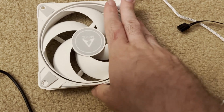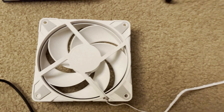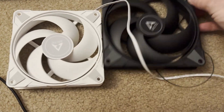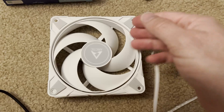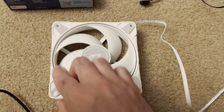Basically the fan looks exactly like the previous one, with straight struts in the back. Interestingly, I also took a look at the P14 at the same time — the P14 has curved struts despite a very similar looking blade design, just obviously beefed up a little bit. The blades on it are nice and thick with a great sweep angle to them, getting narrow in the middle, and of course it's got the ring on the outside.